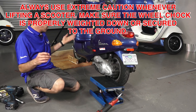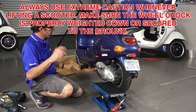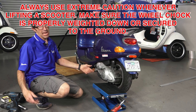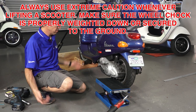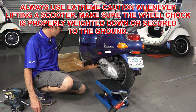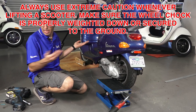At this point I could jack the motor up, and this is the perfect example of an application where you drain the oil. The scooter's tipped a little bit to the right and the center stand is up, because it's very difficult to change the oil on these modern Vespas with the center stand down — the oil just drains onto the center stand. You could service it pretty easily and remove the rear tire. At this point you can pull the center stand down, remove the rear tire and service it. There are many different applications for how you could use this; you can pretty much do everything you would do on a lift.